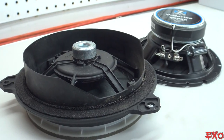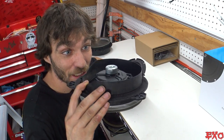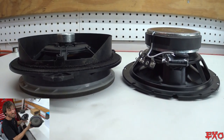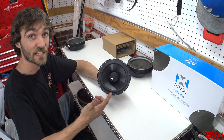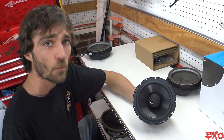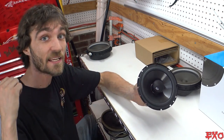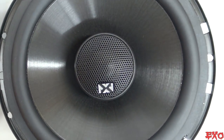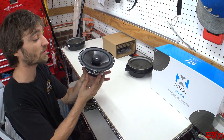Being 50 watts RMS, it'll be a welcome upgrade from the stock speakers. Look at the magnet on this stock thing — it's damn near nonexistent, with a plastic frame, very chintzy, like two ounces. Now you're probably asking why aren't we just sticking a component set in the doors? To tell you the truth, I just wanted that added extra oomph with another tweeter instead of replacing the existing one. So now we'll have two tweeters, and overall it's a pretty well-built speaker for the price, so it should last quite some time installed in that location.